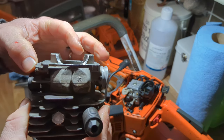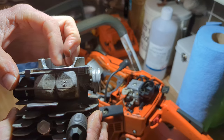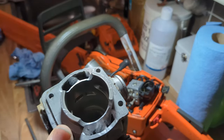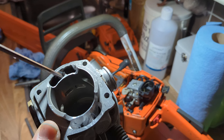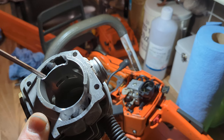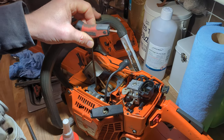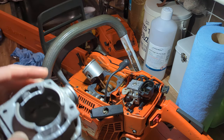The main thing we've done is cut down the height of this transfer here — it's much higher stock, there's about another quarter of an inch of transfer in between. Then what I've done is knife-edged the divider down inside — I've biased it towards the primary transfer. This is the primary one, the big one; this is the secondary one. The primary transfer I've made bigger, and I've just tried to take up more of this space here, so it uses all of this opening where the air comes out of the case.